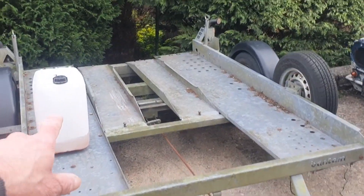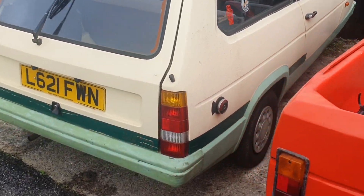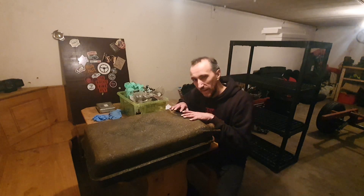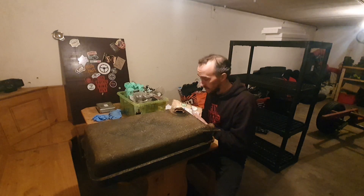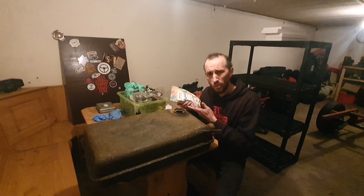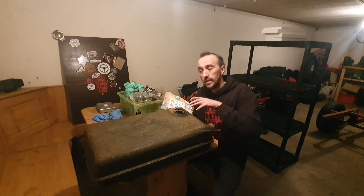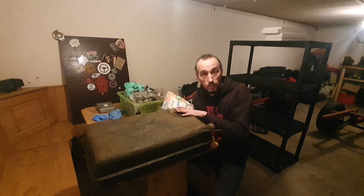The plan is to run all that old petrol through a 0.5 micron filter and get it back in. So this is a replacement tank and the next job is to de-rust it before putting it on the car. This one looks fairly good inside, but there is rust all around the inside. Apparently the best way to do this is citric acid - just citric acid you'd use for cooking. I'm going to pour the whole bag in, fill it with water, leave it overnight, then pour the water into a container to keep for de-rusting other parts. Hopefully that should take the surface rust out of the tank, and then we'll treat the edges with some Kurust to tighten it up.